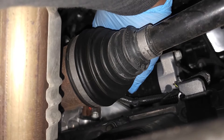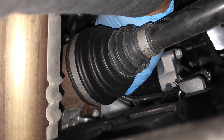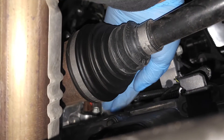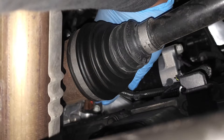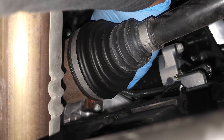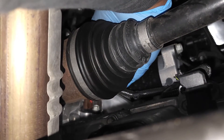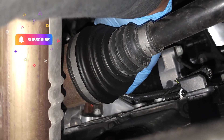Examine the sensor itself. Once you determine whether it needs to be replaced or not, you can go ahead and install the sensor. You may need to rotate it 90 degrees so that the screw is lined up. If you're replacing the sensor, you'd want to put a small amount of lithium grease or dielectric grease on the O-ring and make sure that O-ring does not get twisted when you're installing it. I think this is pretty straightforward. The primary thing here is actually identifying the sensor and its location — and I think that's the pro tip for this video.